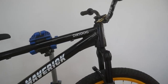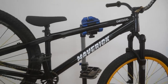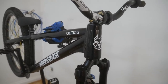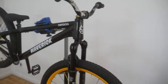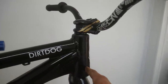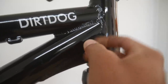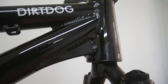The last thing for real now is the frame, and it's easily my favorite part of the bike. It's a pretty sick looking frame, seems to have good geometry, it feels really good to ride, and it seems like it would be pretty strong. Another good thing is you're not really limited on parts — you can actually run some of the best forks on the market because it has a tapered head tube. That means you can run forks with a tapered steerer like RockShox Pikes, DJs, and Fox 36s. Where the bottom tube and head tube meet is usually where cracks form, and this bike has a lot of reinforcements there — it's really thick with really nice welds.